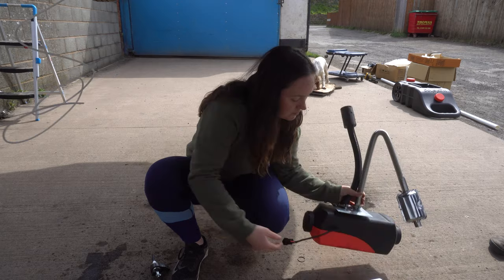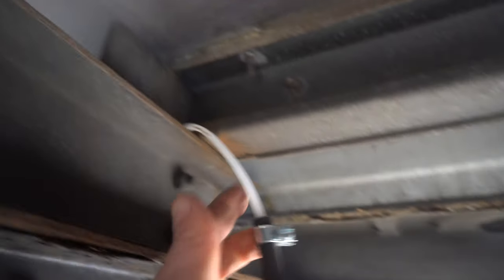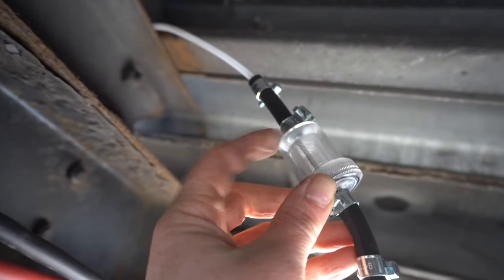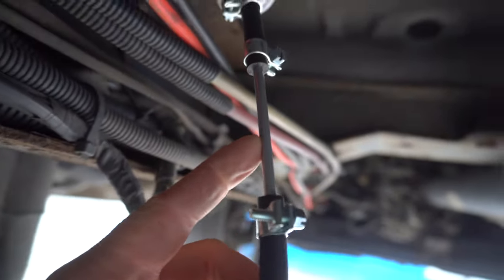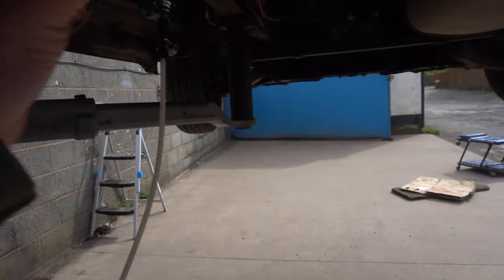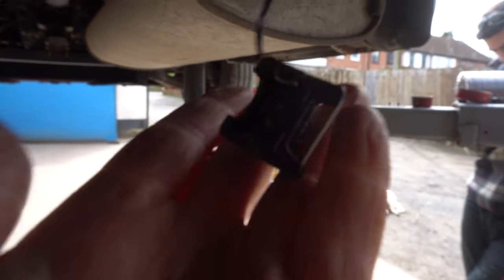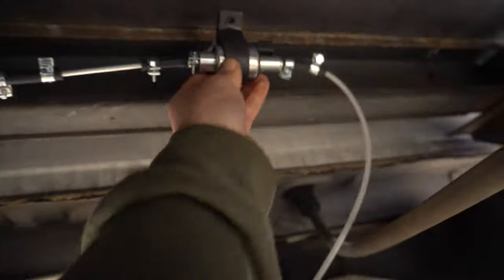This is going to be mounted to the underside of our vehicle over that direction. So from the fuel line: jubilee clip, rubber piece, jubilee clip, filter with the hollow end towards the fuel tank, then the filter section, jubilee clip, rubber, jubilee clip, our metal piece into the pump with its little rubber holder, into our clear pipe again. The other piece we need to attach from the kit goes onto the fuel pump right there, so let's get that attached.